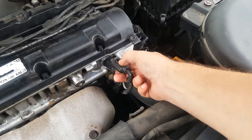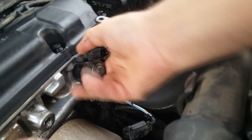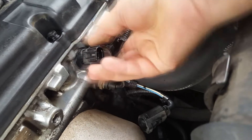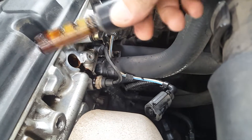First, remove the power cable — press the clip down and take that away. There's a 10mm bolt down here; get a ratchet on that and take it out. Now with this here, there's probably carbon on it so I'm going to have to keep wiggling and working at it to get it out. Using both hands — and that just pulled out.